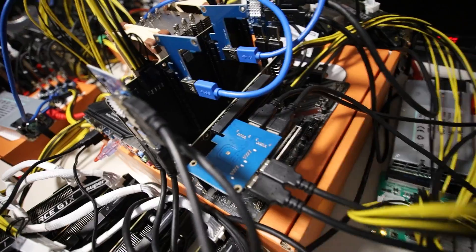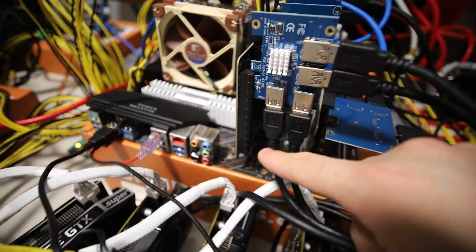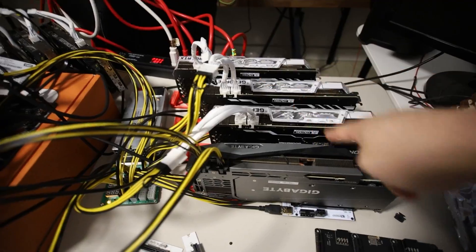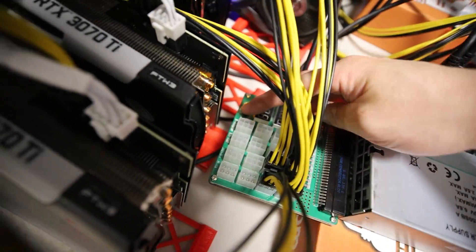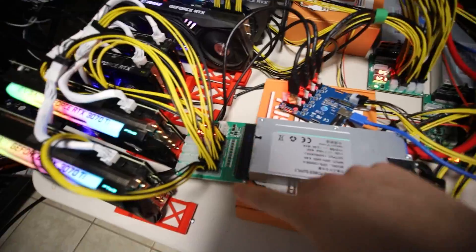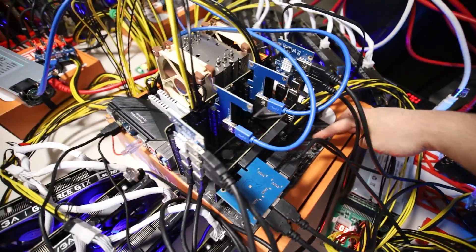I was able to put another bifurcation card in — the smaller half-size one. You can see the difference: this is a lower-profile one versus the full-size, and the PCIe slots are oriented vertically instead of horizontally on the low-profile version. I've got three 3070s and one 3080 Ti to add. I'm turning on the power for this one first, then those four in the back. You may be wondering why I'm not using the floppy cable method — I had a weird shorting issue with those cables from Parallel Miner where one was turning on while another turned off, so I removed them. All the GPUs are now on.